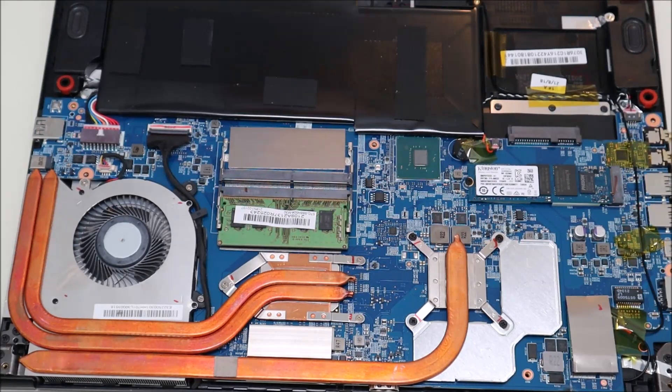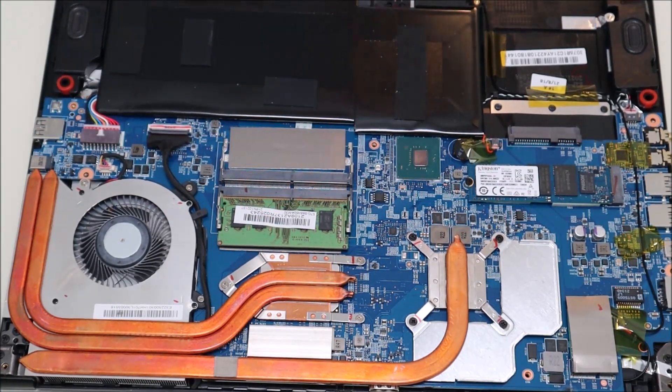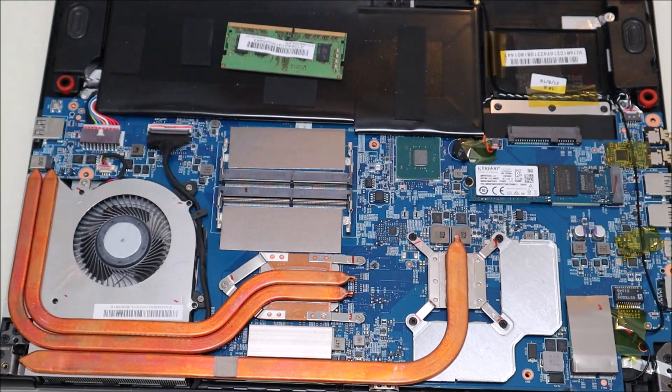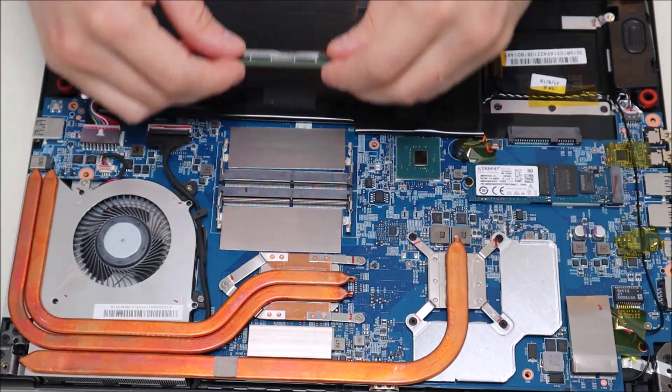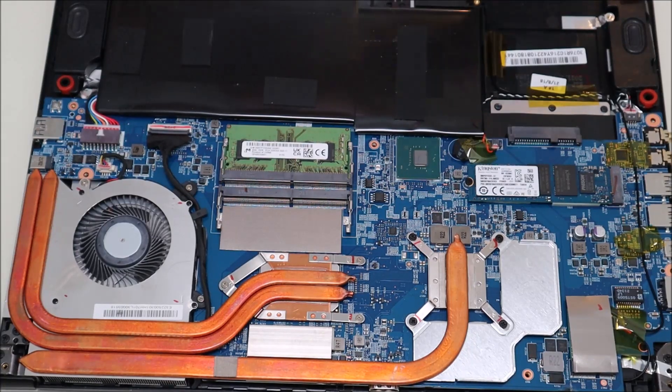If you only have one RAM stick, you should purchase another one that's good. To test the RAM, remove one stick, leave one stick in, and try turning the computer on. If the computer turns on, it means that stick was most likely bad — you would replace it. I'll have a video link up top as well as in the description to show you how to buy compatible RAM. If the computer doesn't turn on, remove the other stick, put that first one back, and try turning the computer on. If it works, then you know you found your bad stick. If it still doesn't work, switch them and try both sticks of RAM in each port — testing each stick alone, but also in each port.